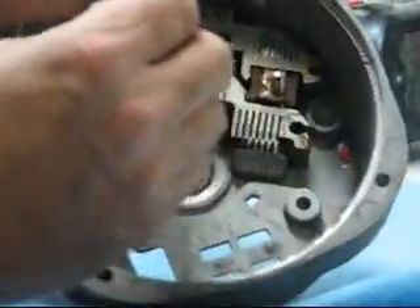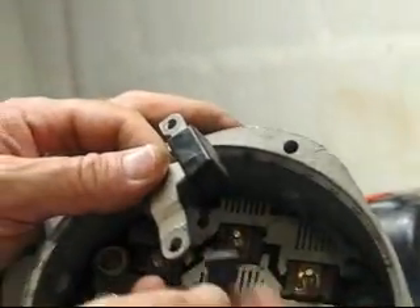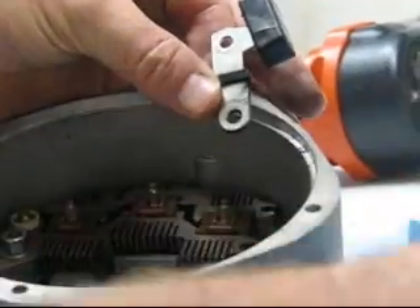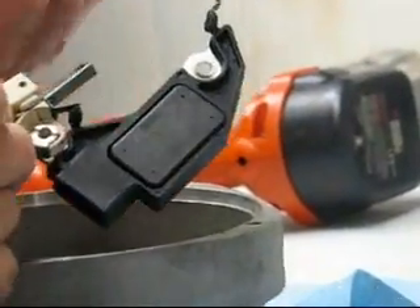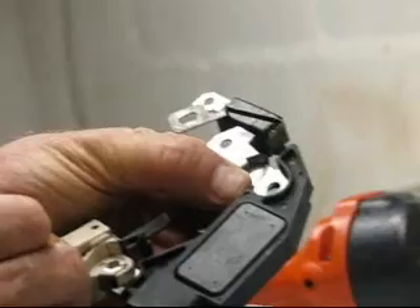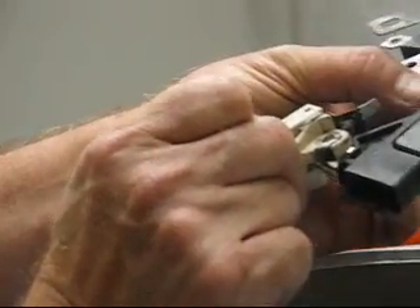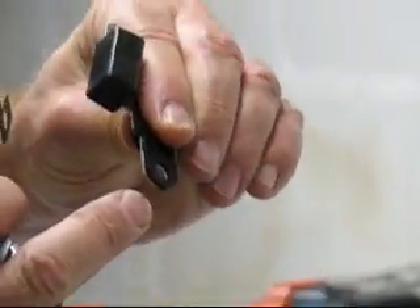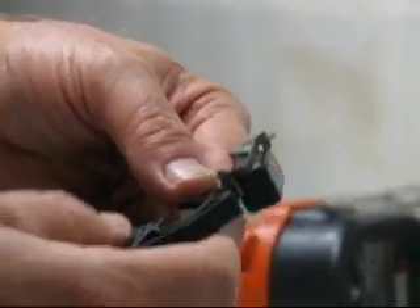This is called the capacitor. I can see this one coming out is broken, so we have to be concerned about that. It goes in here and jumps across the bridge rectifier, and this little rib supplies power to the voltage regulator. When we reassemble this, we have to make sure we get the insulated part of the bridge rectifier on the proper side of the voltage regulator so that it makes electrical contact. That has to be in the proper relation because on the back side of the capacitor is an insulator — that insulator has to be down and the voltage regulator has to be over the top of it. We'll go over that more later.